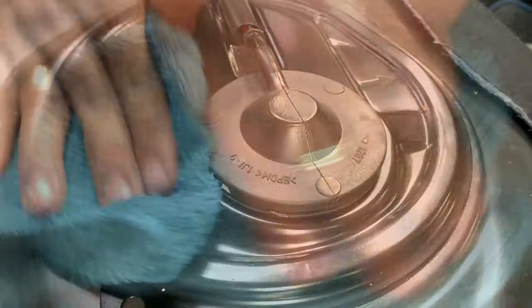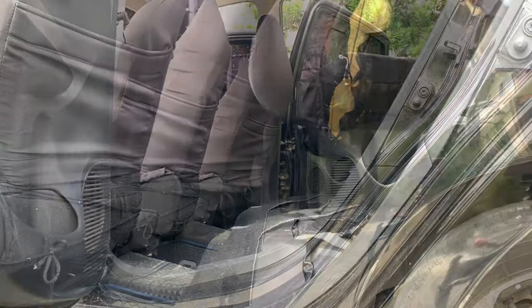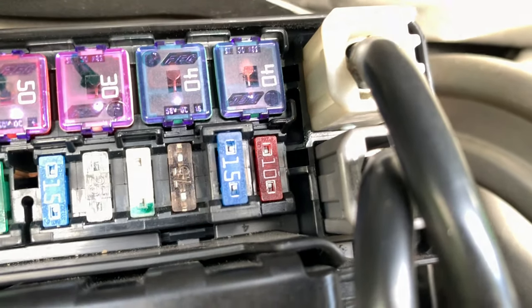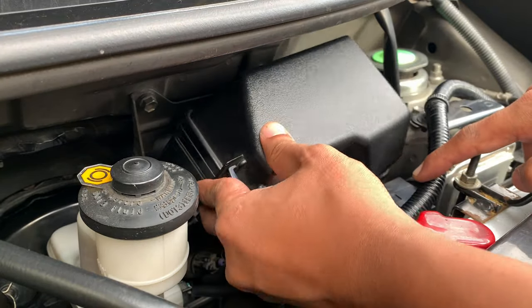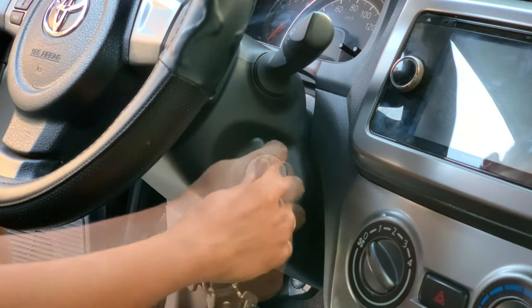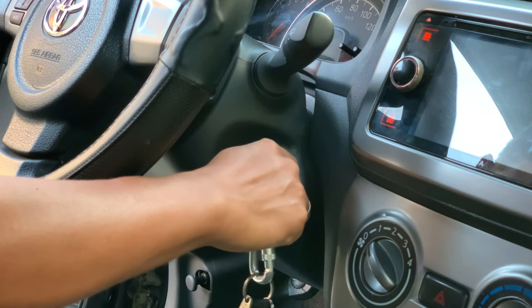Reconnect the power connector harness and reinstall the metallic plate on top of it. We'll clean this area too before we reinstall the rear seat cushion. Reconnect the 10 amp fuel pump fuse in the fuse box, then place back its plastic cover. We'll turn the key to the run position twice — this will put some pressure on the fuel lines. Then we'll start the engine.